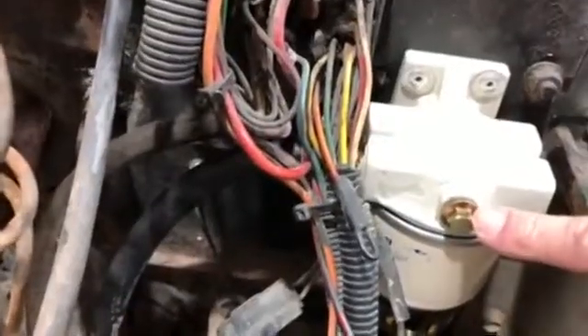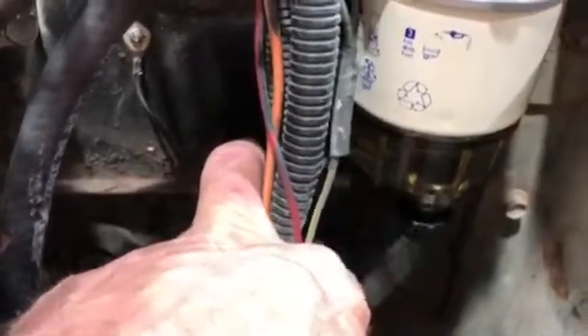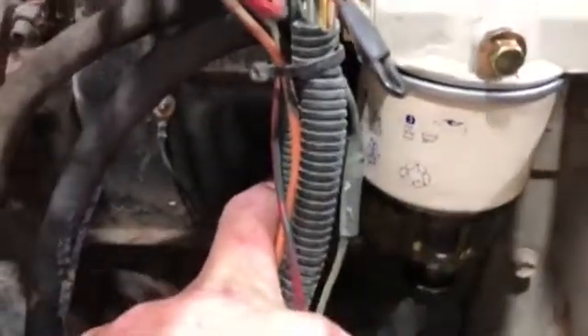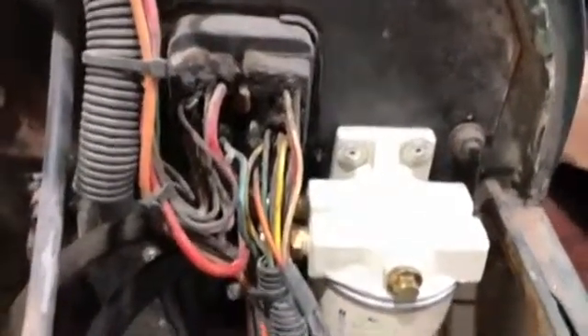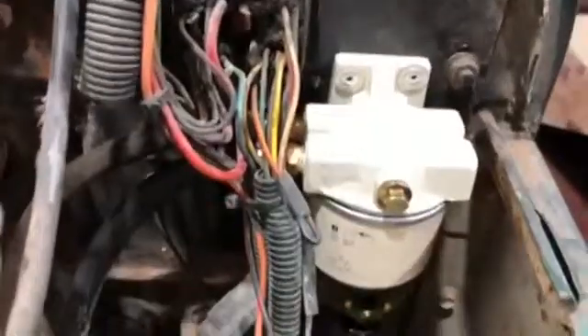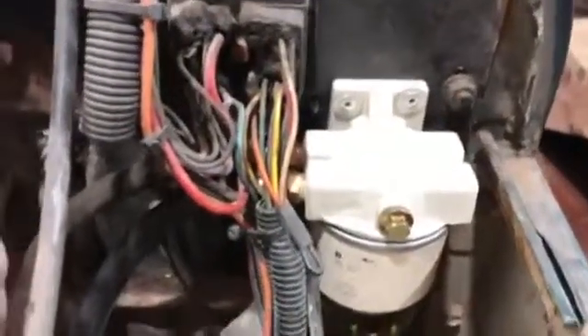This is the air purge, and down here — removing some wiring — that is the water basket, and this is the water drain. I attached a hose to it so it wouldn't drip all over my vehicle; simply open that and it goes out the hose. Whenever you see water sitting in here, drain it. I chose to rivet it so I didn't have to reach around and put nuts on the back of bolts — some people bolt it, some people rivet it. Took about 10 minutes to install — very simple job.